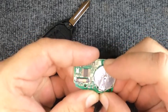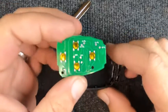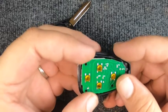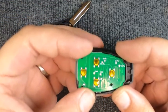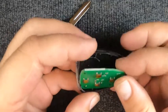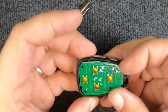Since this is a new remote, we'll put the good battery back in — just push it in and there you go. Now let's reassemble it. Set the circuit board in tip first, and when you set it down you will see there are little indentations to hold it. If you put it in and it doesn't want to hold, pull it up and go the opposite direction — they can be finicky sometimes.